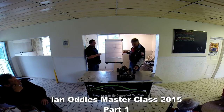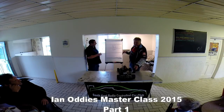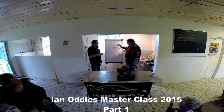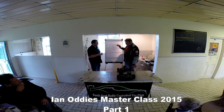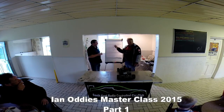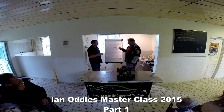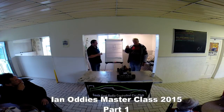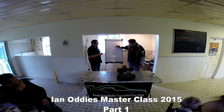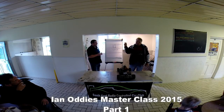It gets a little bit more complicated in the front with caster and cambers and bits and pieces. It depends on where you want to go with all that later. But that's critically important. The worst thing you can do is end up with positive camber in a corner. Because then you end up with that teardrop the other way around, and you end up with snap over straight away, especially on the bike. You'll start pitching into the corner, and your footprint gets less and less, and then you end up on the outer edge of the tyre, and all of a sudden it'll just go straight away.